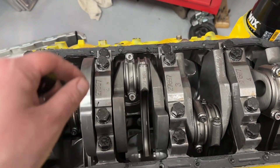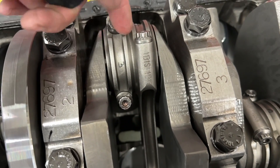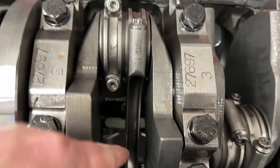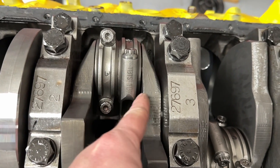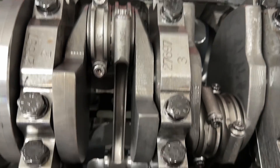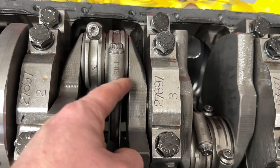In most cases, what you see is rods that are pretty close together — so the two rods, say three and four, they're really close together. They might have a little gap, right? And if you shift the whole thing down, you'd have the same gap. What's happening is to keep the rod centered on the piston, the two rod caps are so wide they're taking up most of the clearance in between, and there's only about a 30 thousandths gap. That's what keeps the rod aligned with the piston — the clearance between here and here. On this type of setup, this is called a piston-guided rod, so it's not guided by the rod itself and the crank.